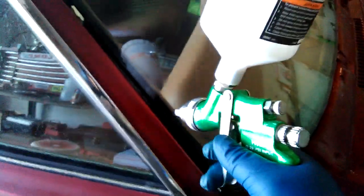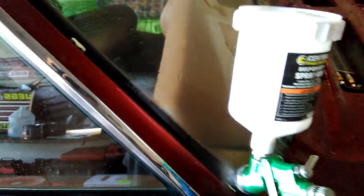and then you fill up your paint gun with it. And what you can do is you can get in here. And it almost works like a pressure washer a little bit. And you can get that rubbing alcohol in the hard-to-reach areas. And what it'll do is it's going to degrease it. And then you can come in with your microfiber and you can shove it down in there. And you can get this area real clean around where the molding is going to go.